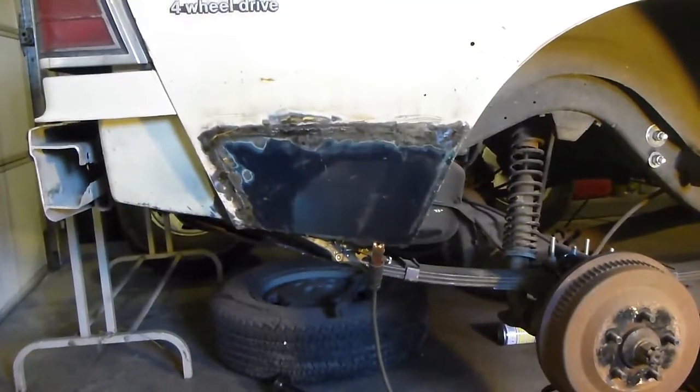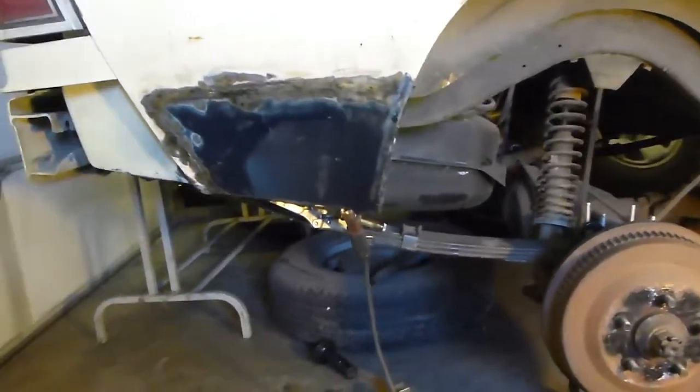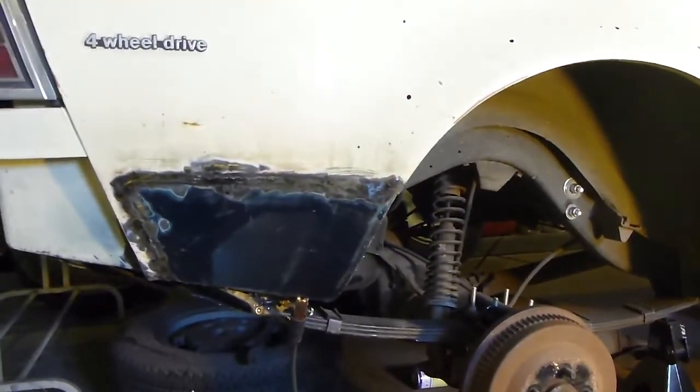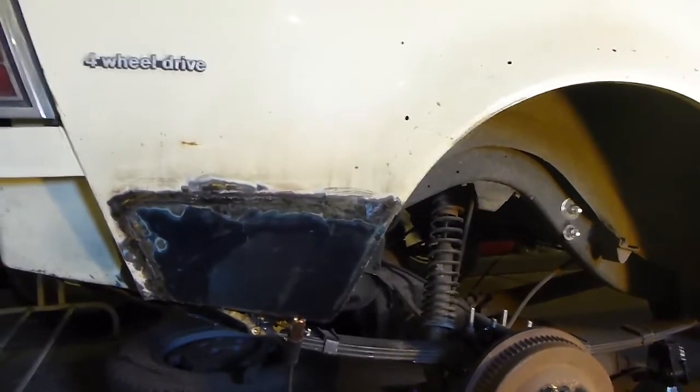I got this in. It's all welded up on the outside, partially welded on the fender seam, and I got a few spot welds up under here. I started to clean it up, checked for pin holes, and I'll finish it up. But now everything's solid, no rot.